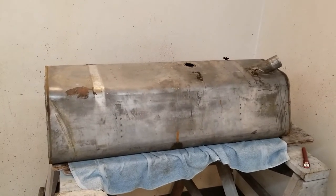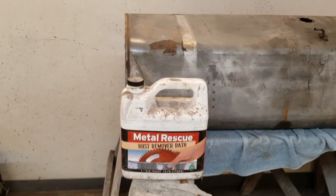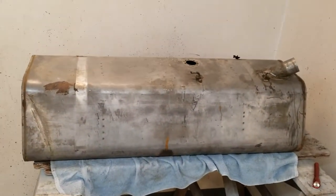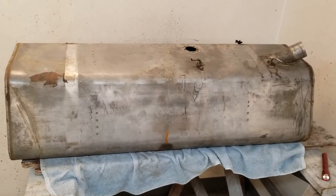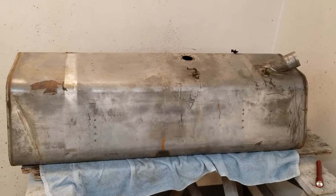There is some staining on the inside, so what I've done is taken some Metal Rescue — a rust remover — a couple gallons of that, poured it in the tank, and threw in a couple handfuls of galvanized roofing nails. I've had that sit for a couple days. I come in and rock it, set it on different sides, keep working it around until all the surfaces look pretty clean. No leaks, no outside rust — just a little bit of staining on the inside.